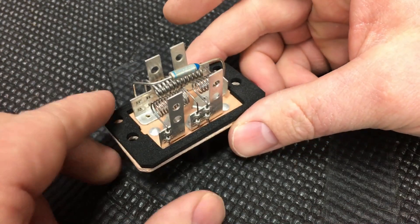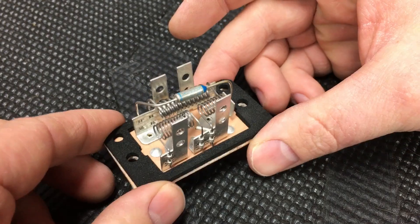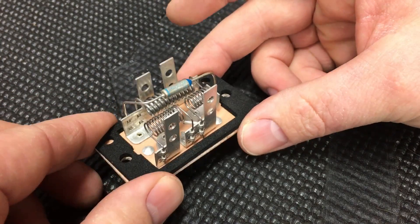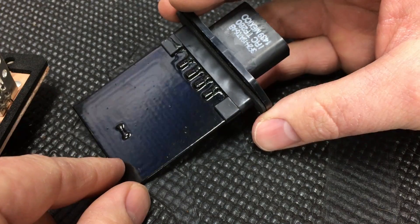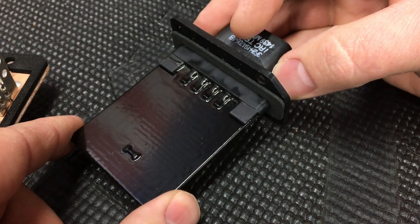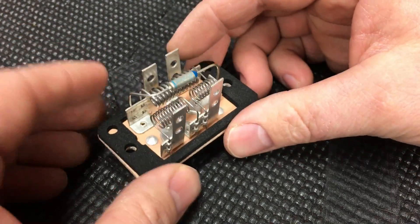The thermal limiter will pop on there, and the parts store will know it because it's going to melt on there — you're going to double the cost of this repair. So if you do find out you need a new one, take the time to take the old one out, bolt the new one in, and then plug it in and test it. This especially applies to the newer resistor cards — those will fail almost instantly if tested outside the case.